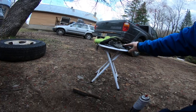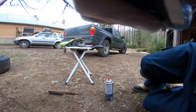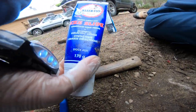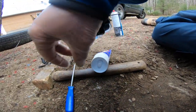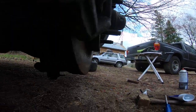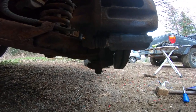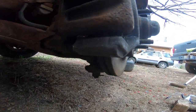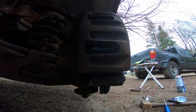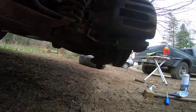I went in there with this dude - a flashlight, not a very good one, but better than nothing. I got my silicone Easy Slide - there you go. I used my trusty dusty screwdriver and got the silicone the best I could on where the brake pads meet that metal clip, as you can see on the side. I put some on that clip, some on that one, and some on the studs.